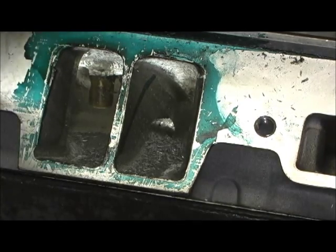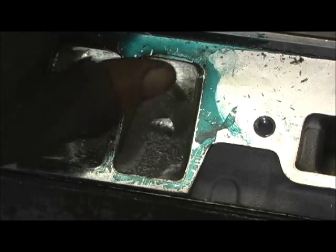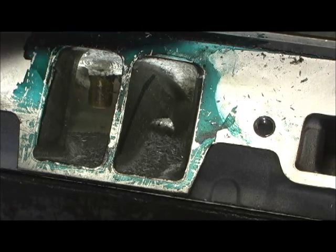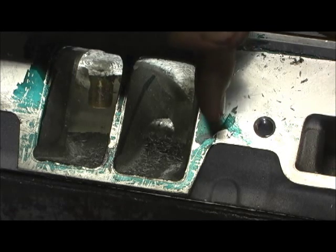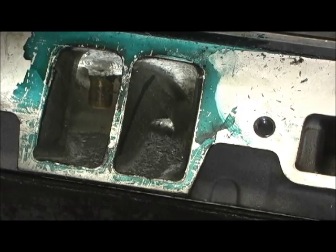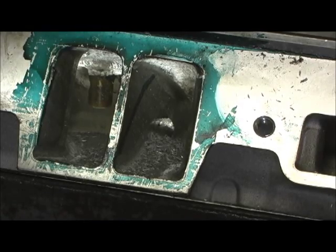That's why going to a 1206 — yeah, you might get the height, but you're never going to get the width straight back. I think even if you have offset rockers and weld up the side of the head, I don't think you can totally get a 1206 straight back. But you get real close to making a straight pull, and that's an incredible thing — it really makes a lot of horsepower when you do that.